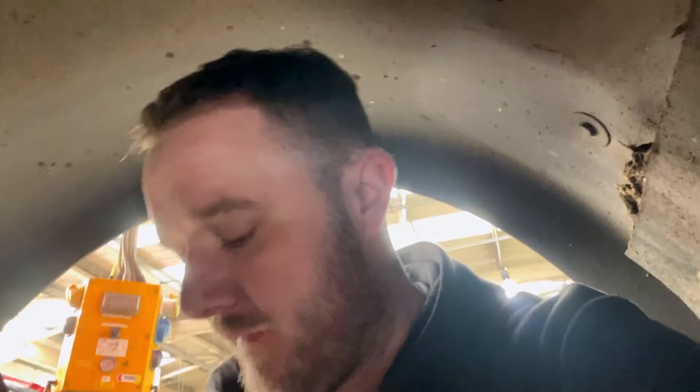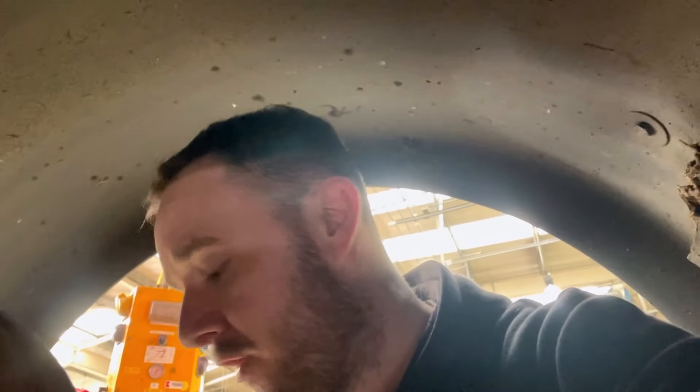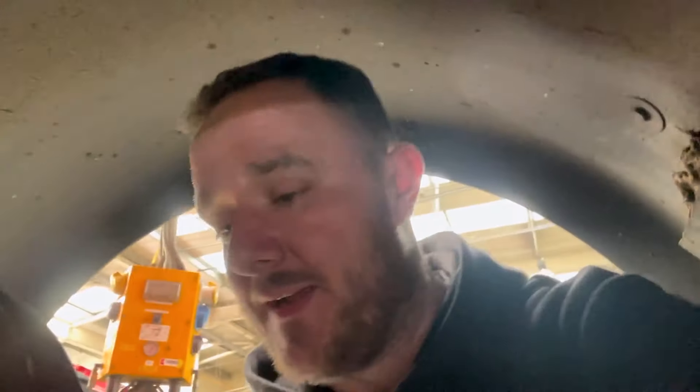Next job I'm going to show you is a leaky seal - my brain is frazzled. So we're going to do that. I've already got the wheels off - I don't need to show you how to take wheels off because most of you know. So 19mm on these - I'm going to get the half shaft all out to get access to it, get the brake chamber off and all that good stuff. These discs are not looking the best, but we'll see about that. Let's get on.